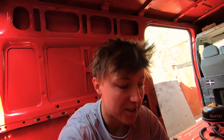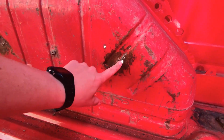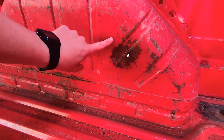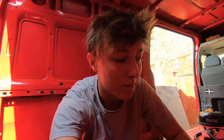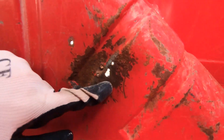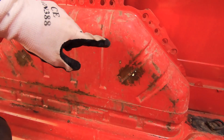The wheel arches actually have quite a bit of rust on them — I've got a hole starting here that goes right the way through. I went to the other side and you can see all the way through. It looks like something's been filled here already. I decided to fill the hole because it's getting bigger — I didn't even touch it and the air is just blowing it away. I've mixed up some filler and I'm going to cover the hole.